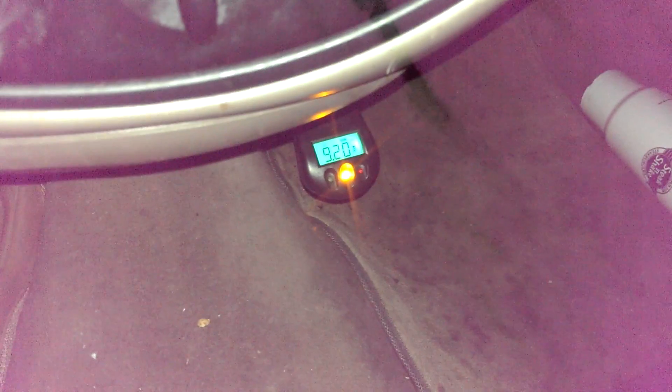Go back in there. I'm going to show the voltmeter here while I try to crank it. Here's the on position — and let's try to crank it. Wow. Battery was completely discharged, and I only let it run for less than a minute there, and it is now starting on its own. That's that good alternator for you. I've got a really old battery, but I've got a good alternator that puts out strong voltage. Took me four tries from AutoZone — went through three bad alternators to get a good one. And she's running under her own power now, charging up.